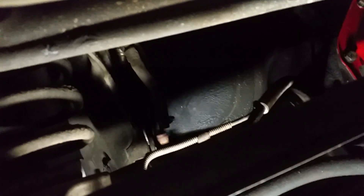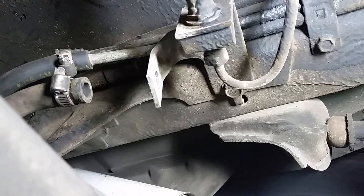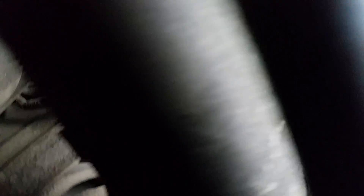Back here at the rear of your vehicle, we're going to put the light under there and slide underneath. If you look up here next to your spring, that's where it's going to be located — it's going to have its own little designated clip. That's where the hose is supposed to be plugged into it, and that little bracket right there is where it sits, and it also goes up to all of your other fuel lines. If you watched my other video, you know exactly where this is because I changed my pump. So this is right under the car right next to the wheel.